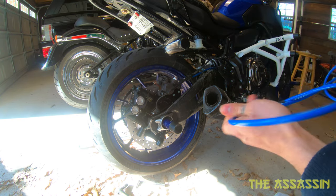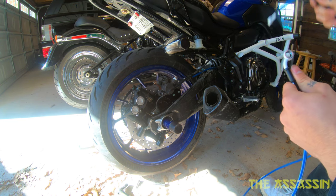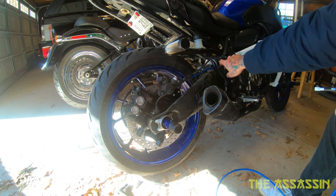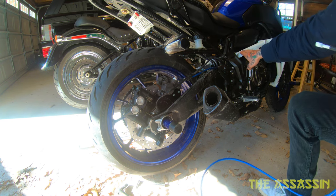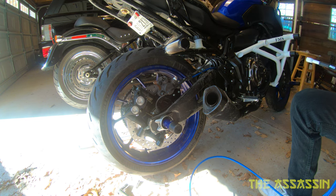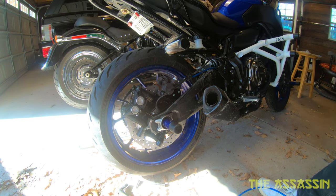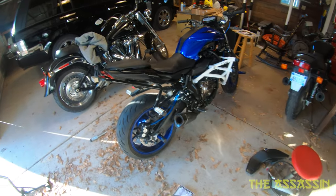This line is steel-braided 80-inch Core Moto line. It doesn't look that big all rolled up but once you take it out - damn. The easiest way to do this would be to route it through your original line holders for everything, then start routing it through and up here around your shock and everything, and eventually bring it up to your master.